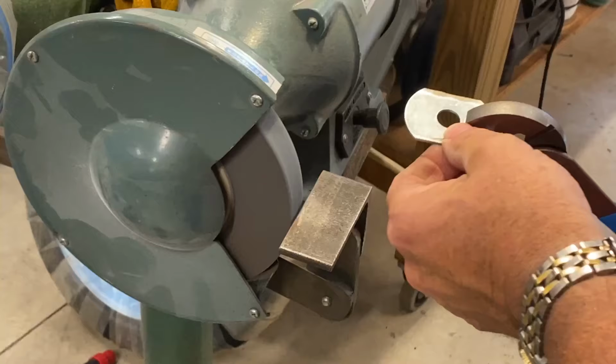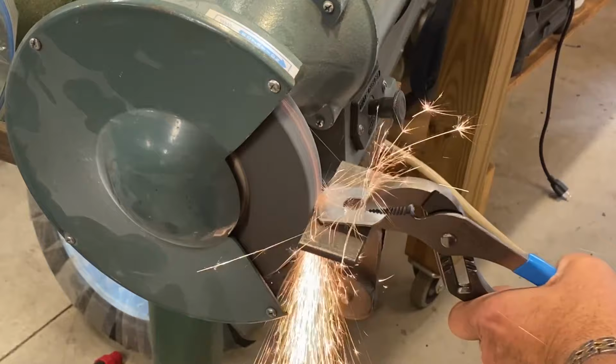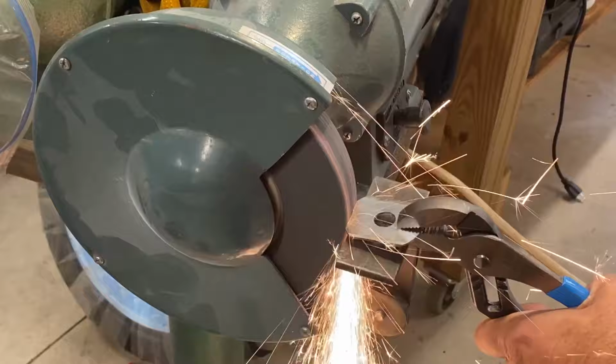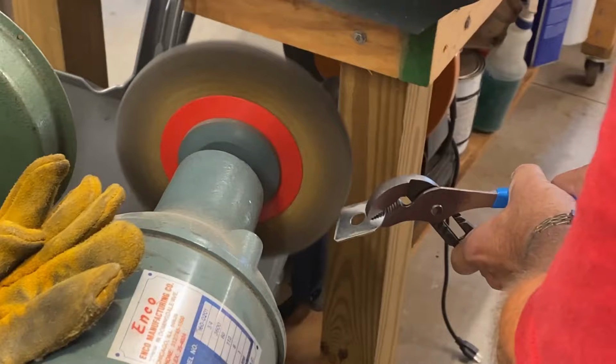The two washers that secure the belts to the outside facing sides of the car were ground down on three sides. To make sure that they fit into the channel correctly, we had to grind them down a bit and then check them with the channel, back and forth a few times, until we were satisfied with their fit.